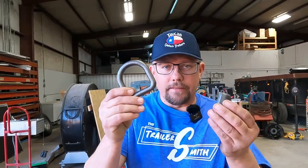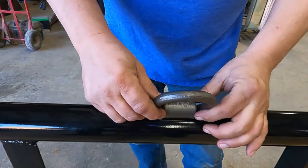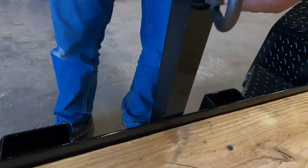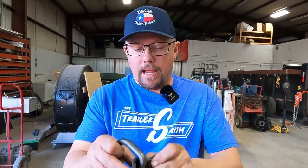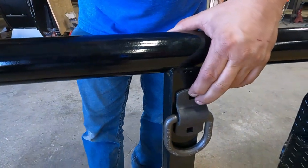How many of you have a buddy that says, 'Hey man, I can weld that'? Well, I almost forgot these. If you have a buddy or brother-in-law that can weld, this is a good way to test them. You can weld these D-rings on your top rail. If you have specialty towing or securement needs, they can be welded down here or in other positions depending on how your trailer is set up. If you find out your buddy can't weld, maybe he owns a drill — you can get the same thing in a flange mount that can be bolted through the floor or anywhere you need.